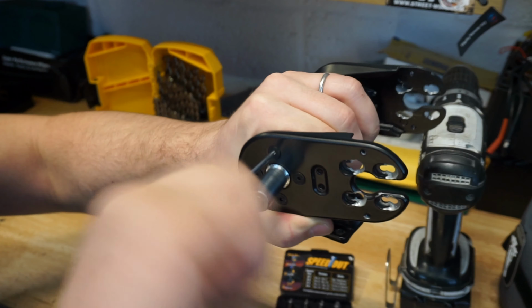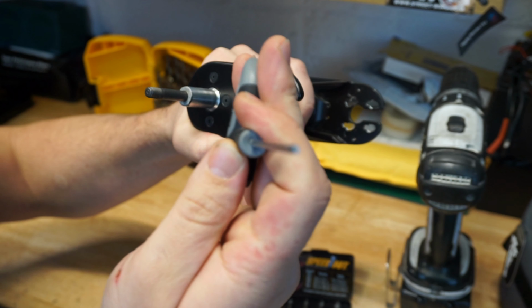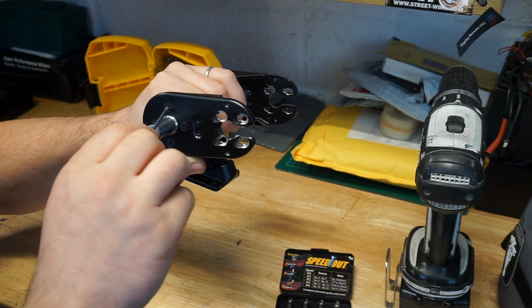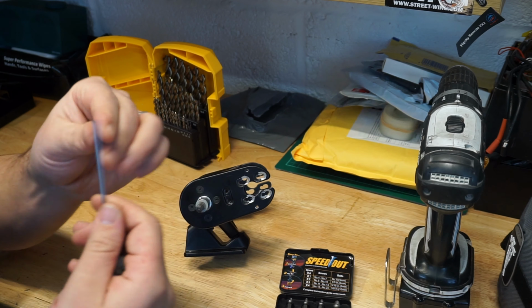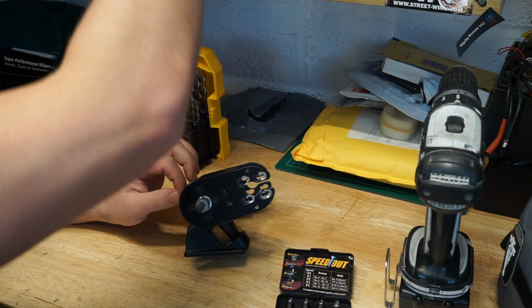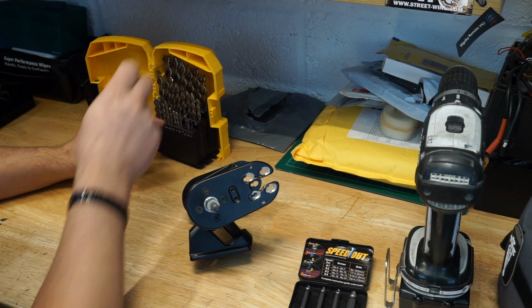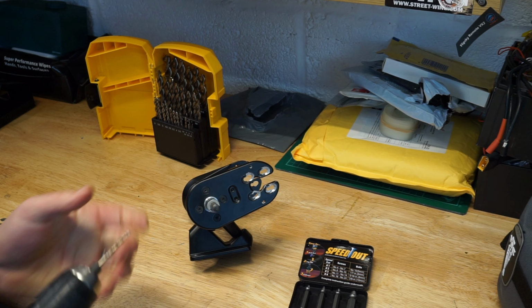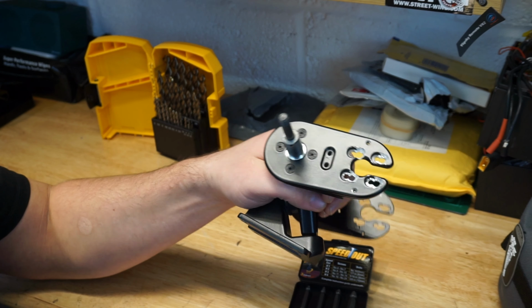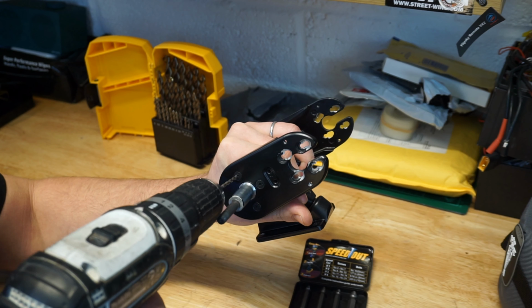Let's start with rounding up the head using the star key. And a lot of people say, well, the star key is another thing you can try if your Allen key doesn't work. I agree with that. It could work. Next step, we're going to drill out the Allen head.